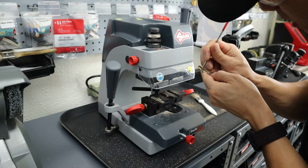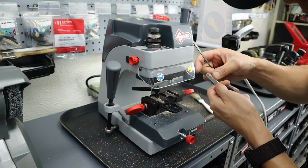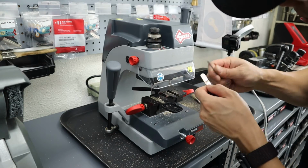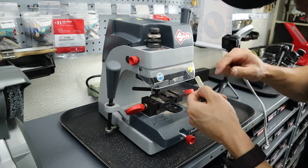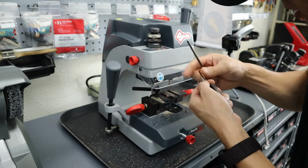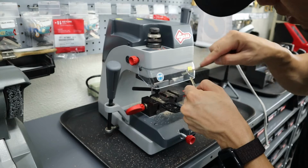You'll also clean it up a little bit once you insert this key into the actual ignition itself, and I'll show you how to do that. You'll notice on the sides, because you deburr it, there's a lot of metal shavings. So I angle it, so I try to take that angle down a little bit, just so it's not so sharp anymore, so it's a little smoother.